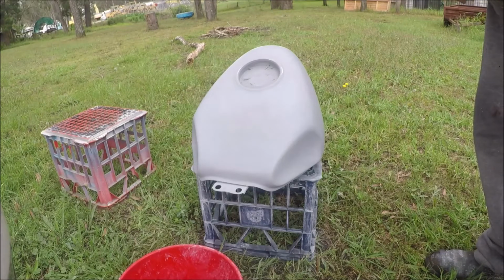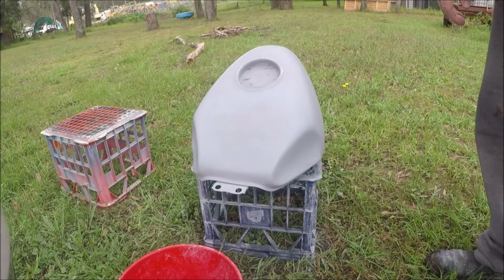If it's too cold, your paint will run. If it's too hot, it'll flash off before it even hits the surface, and it'll give you a very rough finish. You can circumvent that to a degree. In higher temperatures, use more thinner. When we're spray canning it like this, because we're not going to bother getting the gun out for a tank, we're really stuck with the mixture that's inside the can, so I would limit it to about 30 degrees. Painting early morning is good.